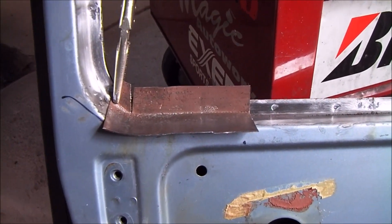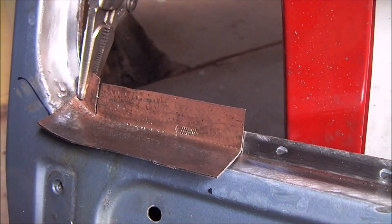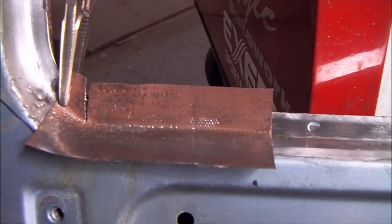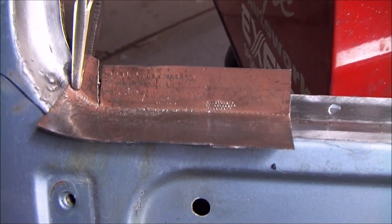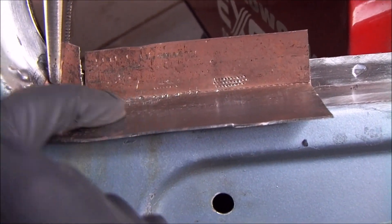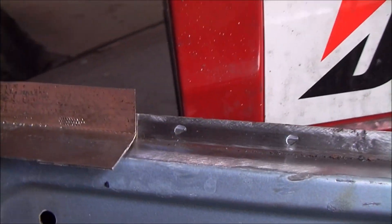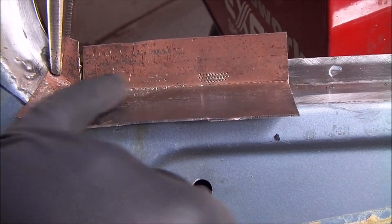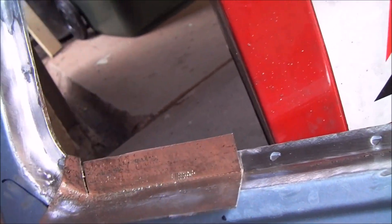I've ground out all the rust and I've started making the patch. As you can see, I've just got a bit of off-cut steel, a chisel, and a hammer. Before I do any cutting, I'll beat the metal into the rough shape that I need. There are a couple of skins of metal there so it shouldn't do any damage to the channel — it's pretty thick. I've had to make a relief cut there to get that curve and I'll re-weld that up. It's pretty close. I've marked the bottom lip, I'll cut that off, give it another couple of beats, weld that up, clean it up, and then I can start cutting out the rust underneath.